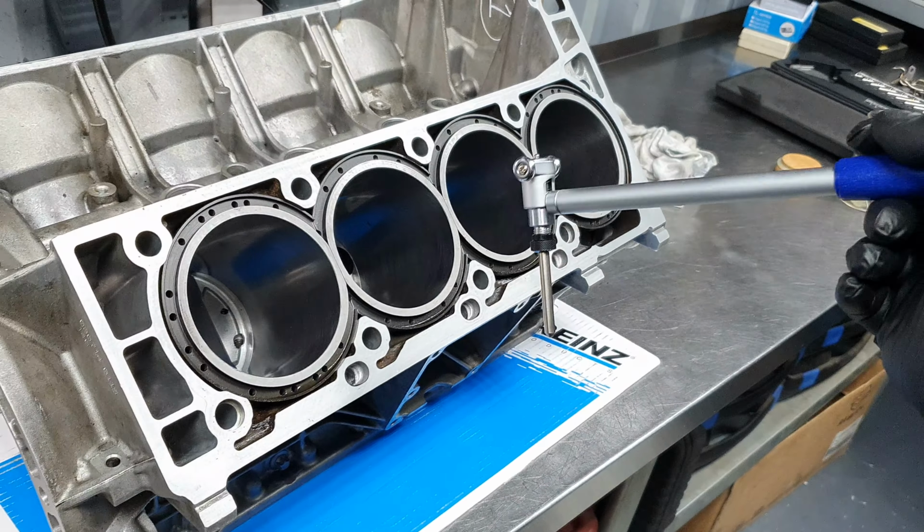The specific one is number 7, alright? You're going to end up in one position. You're not going to seal properly. You have a round piston ring on an oval cylinder. Makes sense, right? Then, if you're saying okay, we're going to put a new piston, think about it.